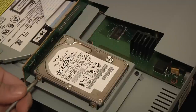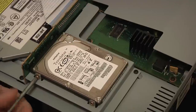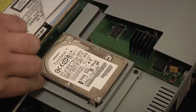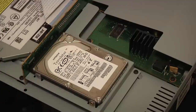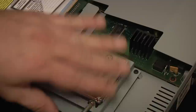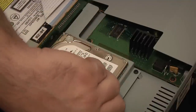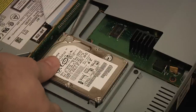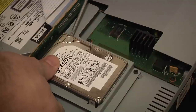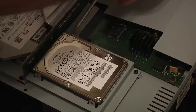Next, unscrew the hard drive. Your replacement hard drive should be a 2.5 inch IBM Hitachi Travelstar IDE drive with 4200 RPMs and no larger than 40 gigs. If possible, try to find a brand new unformatted, unpartitioned drive, because Yamaha uses its own special format structure. If there's a master boot record on your hard drive from a previous Windows installation, it won't work. You have to erase the master boot record first, but don't worry — I will show you how to do that using Windows 7. You can also buy a used one.